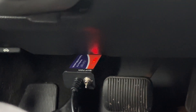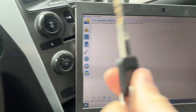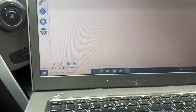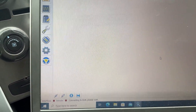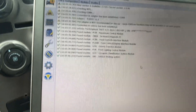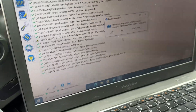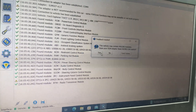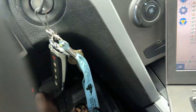All you need to know is that I have my OBD2-to-USB hooked in, I'm within Wi-Fi, and I need to turn my key on — so I'll put it in the start position without actually starting the car. I'm going to connect, and it's telling me that I have the HS position on, which I do — right down there the switch says HS. I clicked on the top connection, came down to connect, it's doing its scan, recognizing I've done this before. It says reading vehicle info. It's telling me to switch to MS, and then once ready I'll switch back to HS because that's what we're using.